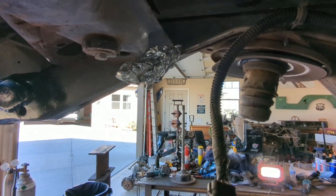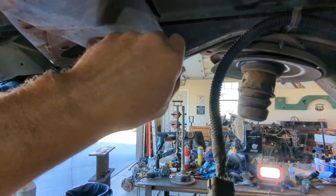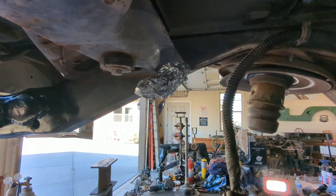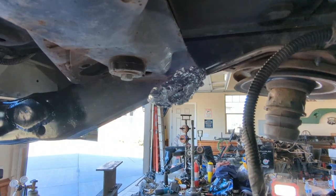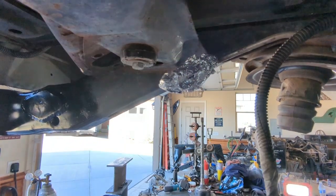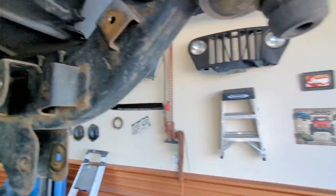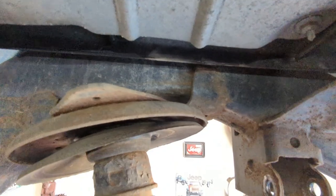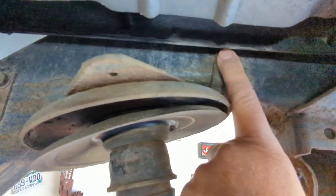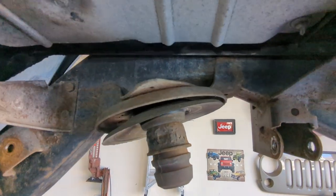That's not the main issue here, but I wanna keep stuff from getting into the fuel line, especially the grinding dust and stuff like that. So if you take aluminum foil, you can crumple it. I double it over, I wrap it around, then I crumple it around. It doesn't fall off and it keeps stuff from getting inside those fuel lines. The other side is pretty wide open, so you shouldn't have any problems accessing that, although you can see that tab up top is kind of far up there, so getting a Dremel tool up there is going to be your best bet.